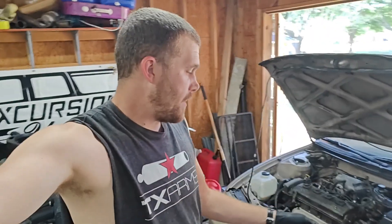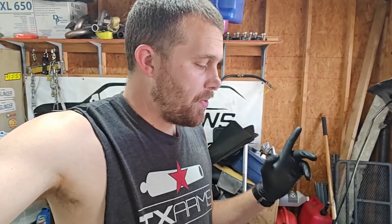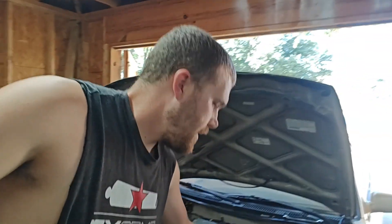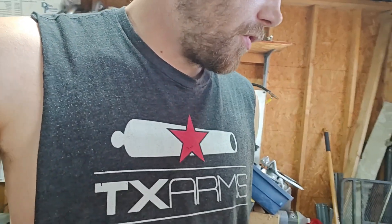That's all there is to it. I'm not going to go through reinstalling everything because if you're watching this you most likely want to get your car running. The capacitor is not easy to find — most auto parts stores are going to tell you it doesn't exist or they don't have it, so you'll have to custom order it with a part number or just order it online via Amazon and get it next day. Also replace the seal on your distributor before you put it back together — mine has been leaking for a long time. If you're on the side of the road in a pinch, you can just disconnect the capacitor and keep driving.